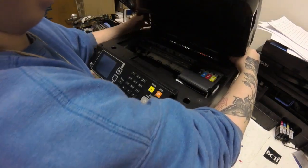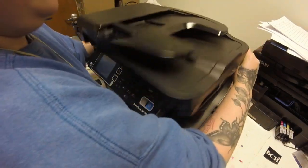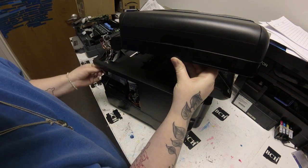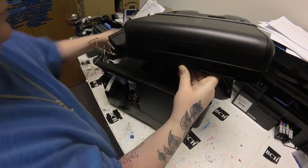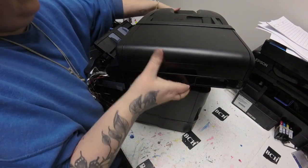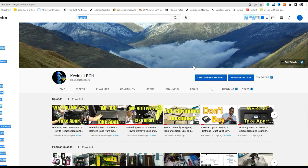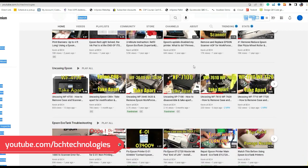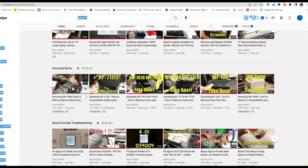As you can tell, I've already taken off the fax cover and I've already undone the wires. Here I am pivoting off the top of the scanner, working on wiggling the wires out from the back and also working on taking out that FFC cable. This way I can disconnect the top of the scanner from the printer. If you want more detail on how to disassemble or remove the case for Epson, you can go to our YouTube channel, youtube.com/bchtechnologies, and scroll down to the section called 'Uncasing Epson' — you should find the 3640 right there.